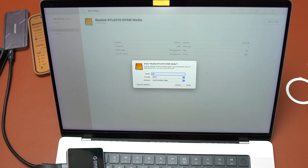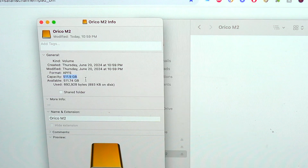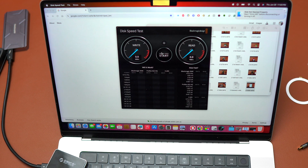On the top right of the screen, click on Erase and you will see a pop-up menu. Give a new name to your SSD, then select the format below. I recommend selecting APFS — this is the preferred format for MacBook and iOS, and it will give you the most speed. The exFAT format is compatible with MacBook, iOS, Android, and Windows. If you plan to use this SSD only with iPhones, use APFS. If you want to use it with Windows or Android as well, use exFAT. By going with APFS, reading and writing speeds will be at the maximum, whereas with exFAT you will lose around 200 megabytes per second.